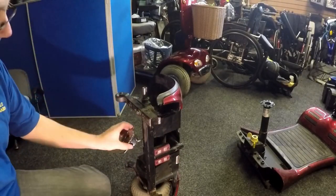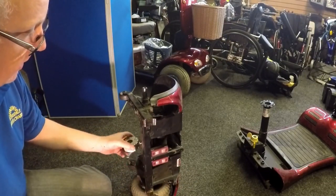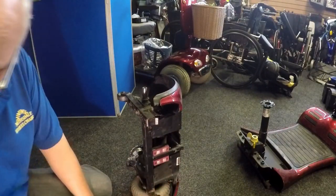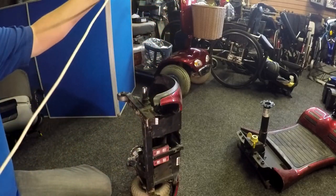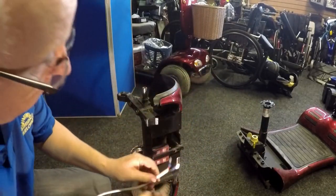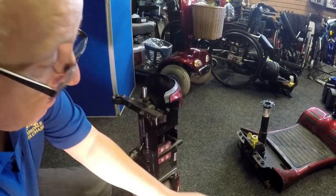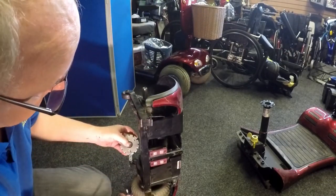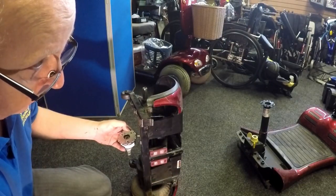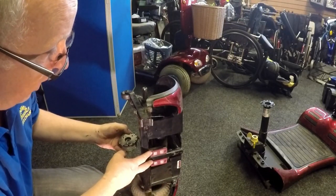Now that I've dismantled and took the brake off, I found out that the scooter wants to go in reverse but it ain't going in reverse. I thought it was the electric brake not coming off. So what I'm going to do is apply voltage. That's your motor connection, that's your electric brake connections. I've got a wee homemade device here which just applies power — there's a battery pack here, plug that in and that'll give me 24 volts. There's the motor spinning away, so I know the motor's working. At 24 volts the brake's blocked on — click — and the brake moves. So I know the brake's working.